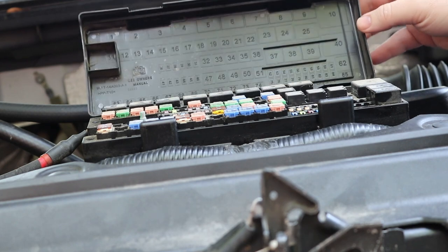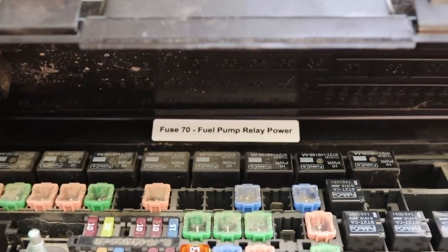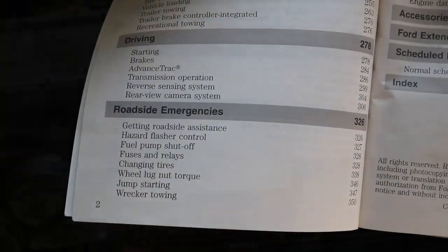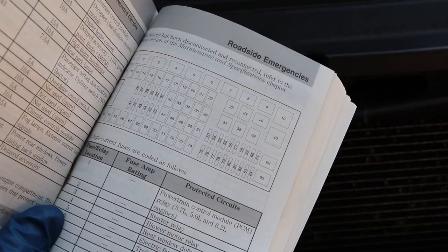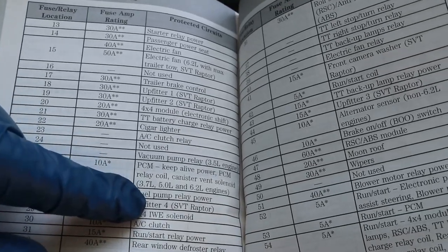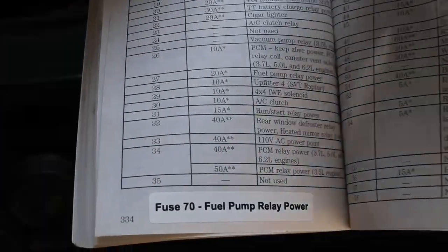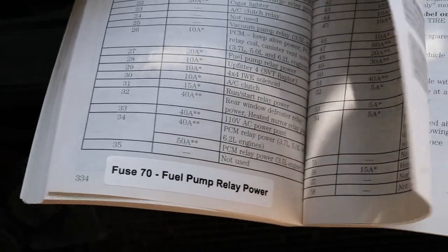Before we reconnect it, we need to open up the fuse box lid and place that sticker. I don't want to cover up our little chart, so I'll put it right here — fuse 70, fuel pump power relay — and we still have access to our little diagram. For the owner's manual, go to fuses and relays on page 328. In that section there's the engine bay fuse box listing — fuse 27, 20-amp fuel pump relay power. I'll put the other sticker right there. Be careful because since it is paper, as soon as you stick it, it will rip the pages. Now if we're looking through our fuses trying to diagnose, we know the fuel pump relay is now on fuse 70.